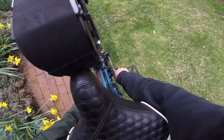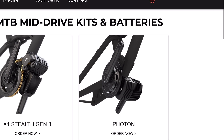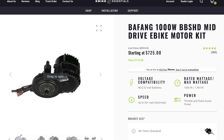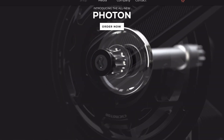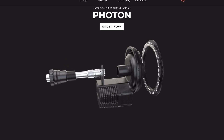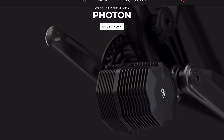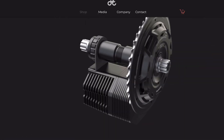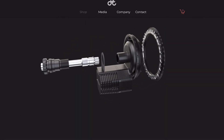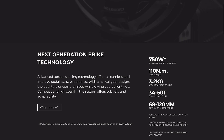The motor and the cog aren't perfectly aligned. But finally with this brand new model, the Photon, they address this and introduce a new design that's much more similar to the very popular Bafang BBSHD. Gone is the exposed primary chain drive — instead they have a direct gear link to the crank arms. This shrinks the size of the product, makes it look more sleek, eliminates that point of failure, and makes the noise level significantly more tolerable.